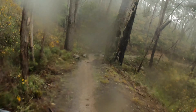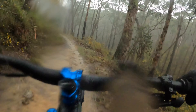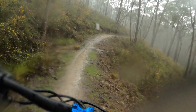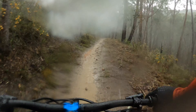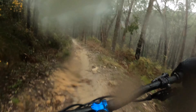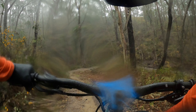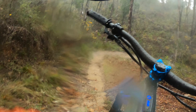Let's see if we can get a bit of compliance now. When those side knobs at the front are on and you lay them over, they're definitely biting or doing something. Like, this should be grippy anyway — it's still choppy. I'm gonna back off the low speed compression two clicks — I've got it at six, go back to four — and definitely slow the rebound down a click on the rear.